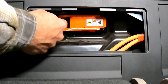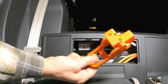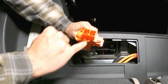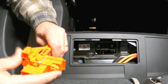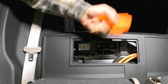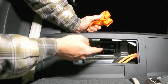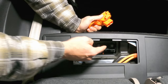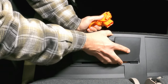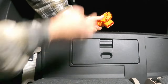Pull this towards us quickly — slide it out and it just pops right off. All this is are two terminals and a short circuit inside. I'll take this completely separate from the car so no one comes back and sticks it back in. Don't put your fingers up in the hole — that's where the 300 volts of the battery is relative to ground on one of those two terminals. I'm going to close this back up just in case some kid crawls in and decides to stick their finger in the hole.